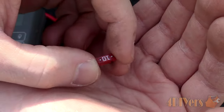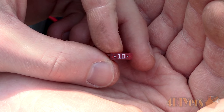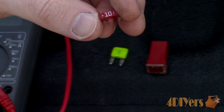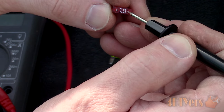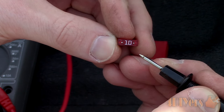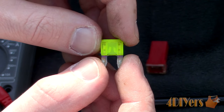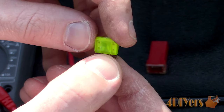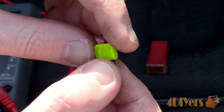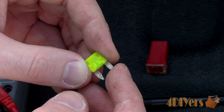Next is the small 10-amp spade style fuse — this one is good. You can see the sides are clear to inspect the fusible link inside. Here are the test terminals on the top when testing the fuse in place. Finally is a burnt out 20-amp fuse. You should be able to see a dark mark inside the clear plastic housing along with a space between the fusible link. This may vary between fuses — sometimes you can feel the loose terminal within the plastic case.